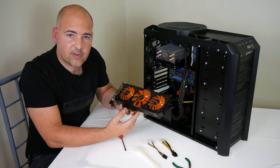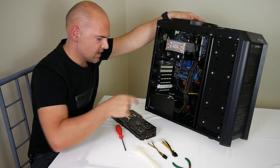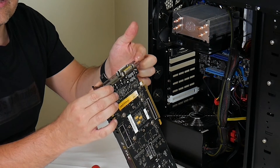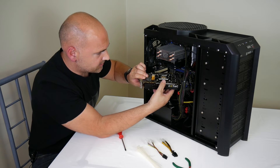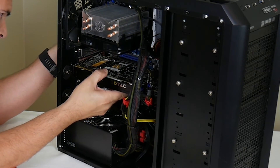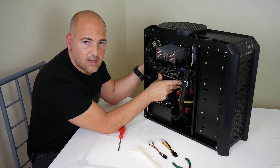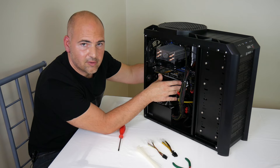The installation is the reverse of this process, but I'll quickly go through and show you. Line up the PCI Express connector to the port, and at the same time line up the lugs on the graphics card back plate to the retaining back wall. Orientate the graphics card in through the wiring and line up against the back wall and the PCI Express port slot. Wiggle the card into place until you hear a click or until it's engaged with the clip. If needed, apply light pressure to the back of the case to stop it falling over if you're working upright.